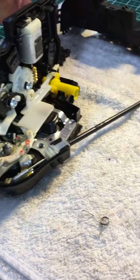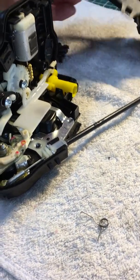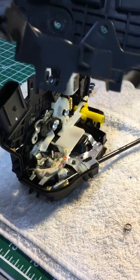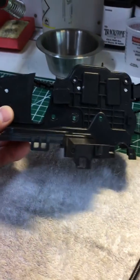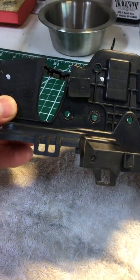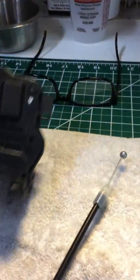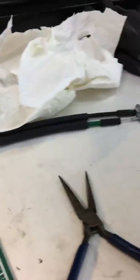I've got a new part on order, found it for about $55 on the internet - actually bought it on eBay. What I did is: I removed the outer case of the unit. I drilled out the two rivets that you see right there in the middle of the screen, then released a bunch of locking tabs all the way around and was able to take that off. Then I removed the cable that goes to the inside lock.